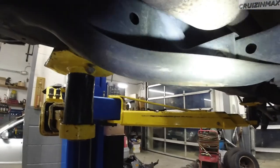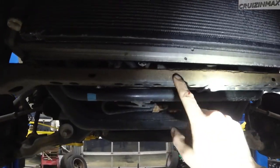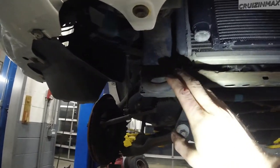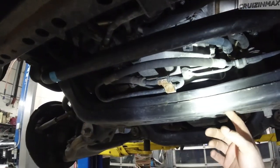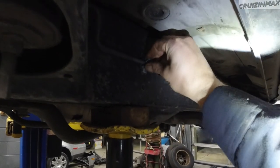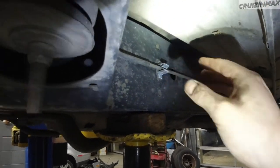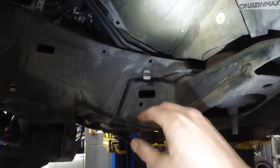There's a little rust in this area, but the worst part of the whole frame is the very front section — that's going to get Chassis Saver and we'll spray Amsoil inside every hole we find. These funny plastic covers here — one just disintegrated, very brittle. I tried taking two of them off and they broke, so I'll just lift what I can and brush paint where I can reach.